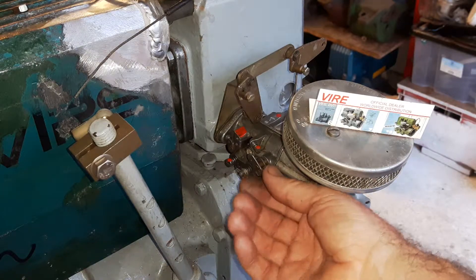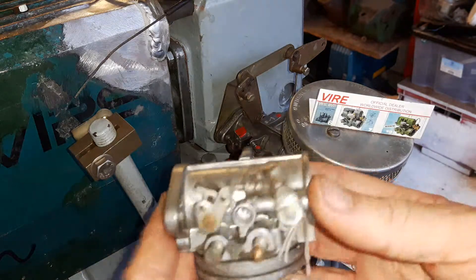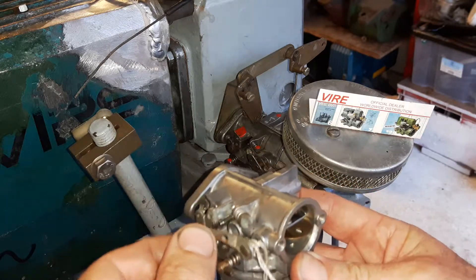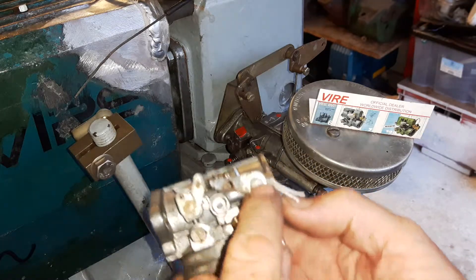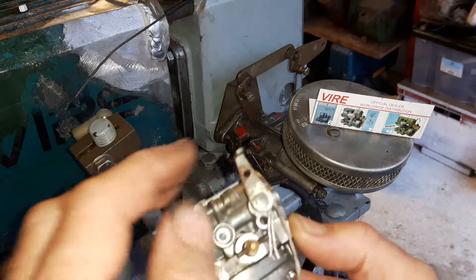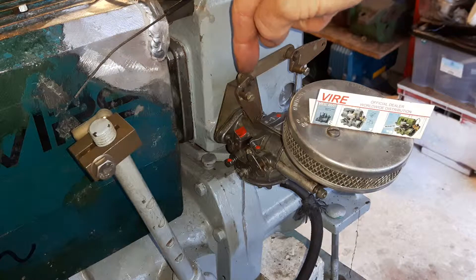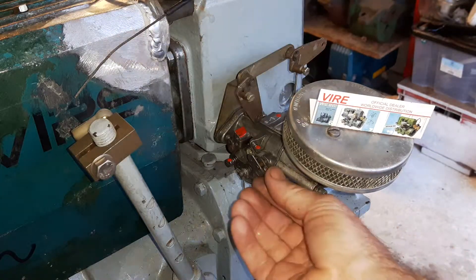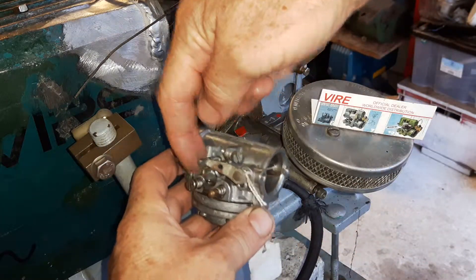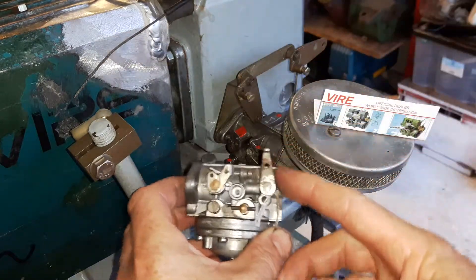Now the new carburettors have a different sort of lever. As you can see, the new carburettor comes with a longer lever which is a lot easier to operate by hand, but you can't spin this around — it goes up and about 40 degrees down. The difficulty is if you have this system which pulls this up and down only, this will get jammed, because when the cable pulls it up it can't push it down.